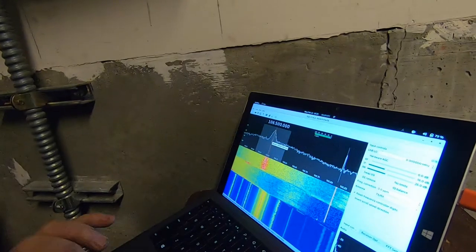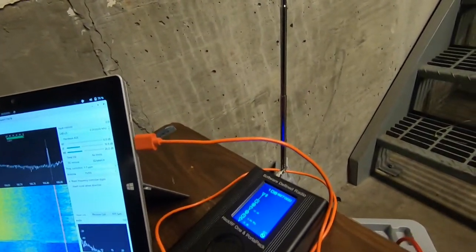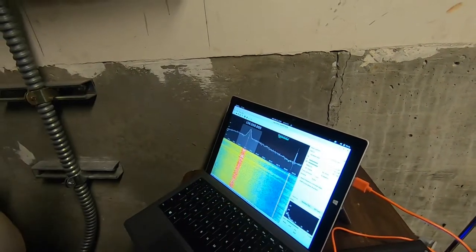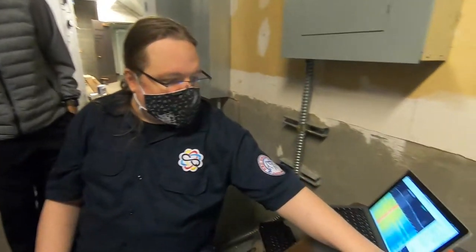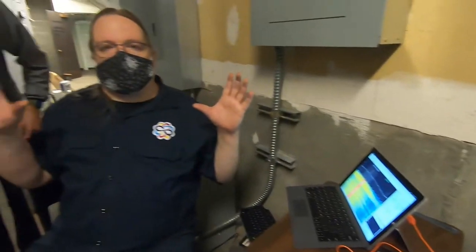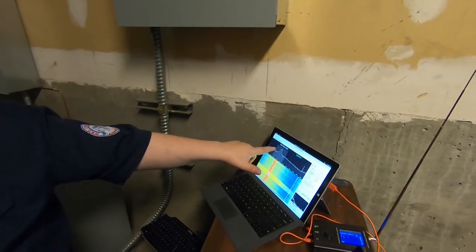And it gives me a sense of what it's looking like, how it's modulating and stuff like that. Now, you aren't bang on the frequency. This is a different frequency than this. This is the midpoint of this chunk of bandwidth that I'm listening to, and then I tune directly here. So the SDR is tuned to 106.827, but it's given me like a 20 megahertz slice of bandwidth, and then within that bandwidth, on the program here, I'm bang on 106.5.